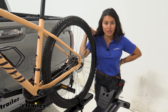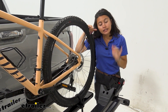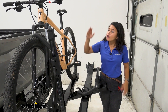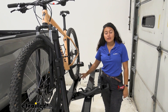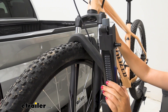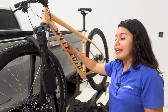What types of bikes can you carry with the Stage 2? You can carry your heavy electric bikes since this has a capacity of up to 60 pounds. But if you are taking this truck off-roading, that decreases to 36 pounds per bike, so keep that in mind before you hit those trails. There are also different shapes and sizes to think about. You have two touch points for your bikes: the rear wheel strap in the back, which also has a cradle, and the front wheel mount up front. The front wheel mount also has a lock that goes around your front wheel, your frame, and into an anchor point, keeping your bikes safe and secure.